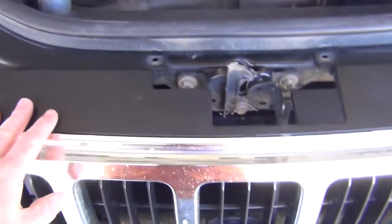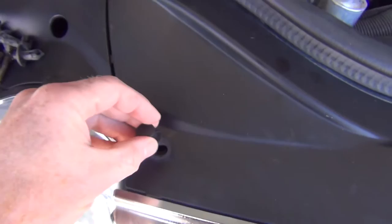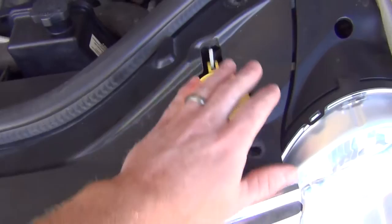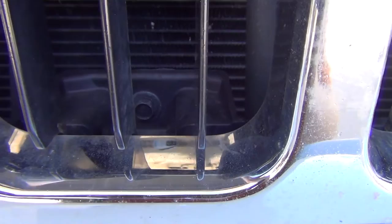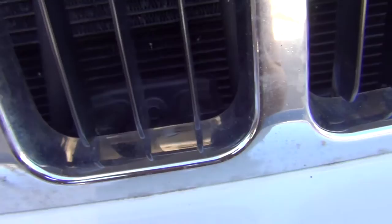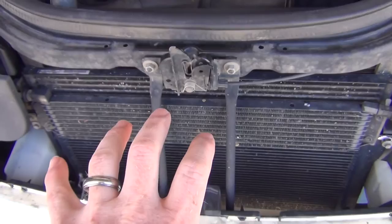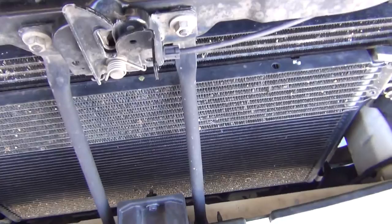To take off the front cover, you just undo these plastic tabs — pry up and pull them out. There are six of them and they can be a little tough. One of mine is slightly mangled but I think it'll still work for reinstall. I also found there's a 10mm bolt in there. I'm back — took the grill out and it just rotates back and comes right out. The only parts really holding it in are those plastic tabs on top.